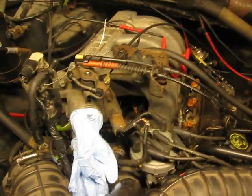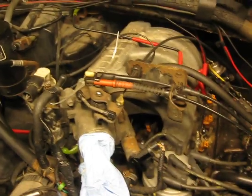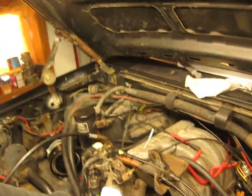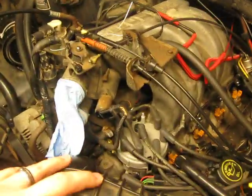After talking to some mechanics, they said I should probably do a smoke test, but I don't have a smoker. So I blocked off the intake ports here and put my injectors back in because I thought they were the problem.